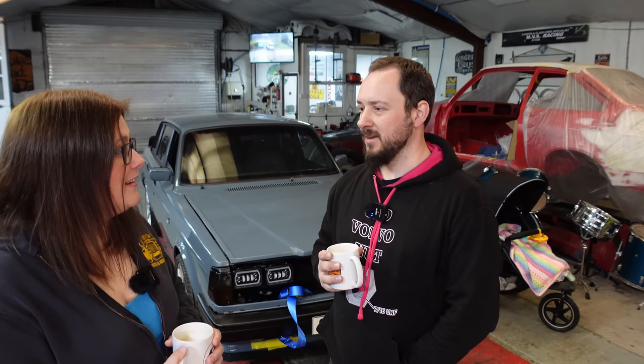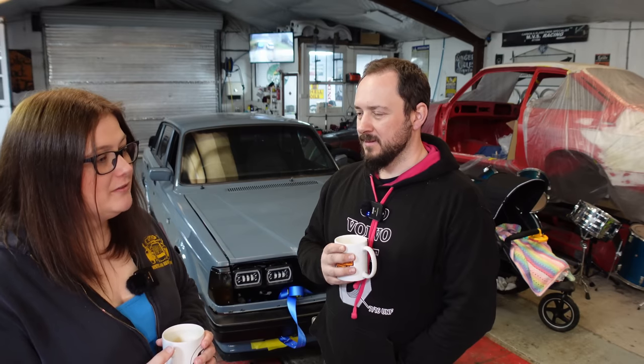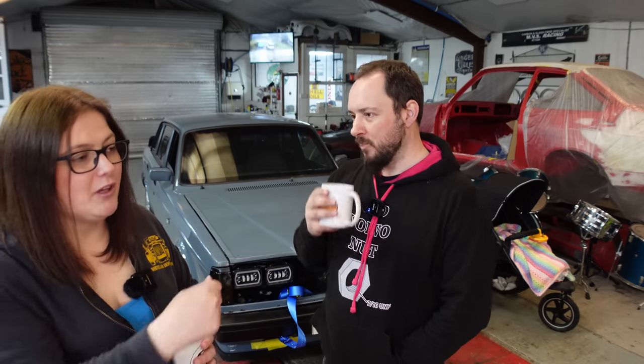We rolled back down the yard onto the ramp and decided to check if there was fuel in the fuel filter — we'd put an inline clear fuel filter in. There was fuel. So annoying. I went to check for a spark — there was no spark, not a dicky bit, not a single spark. How is there no spark when there's always been a spark?